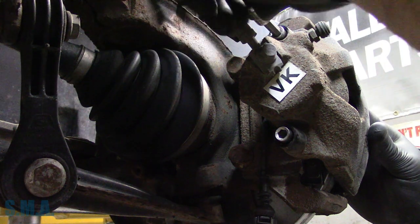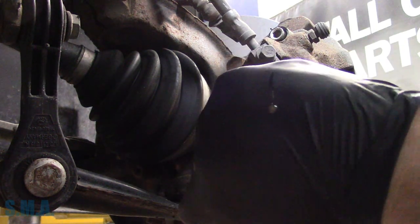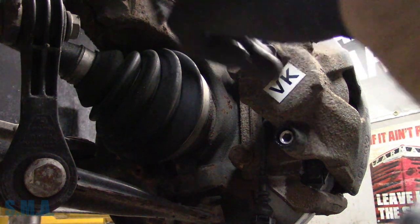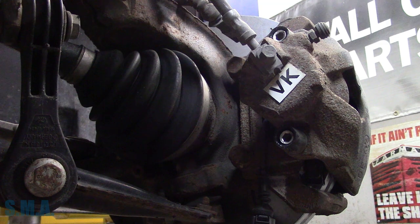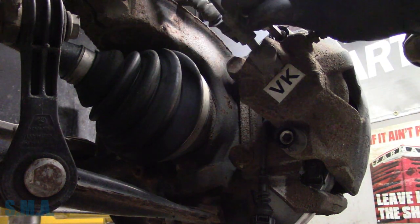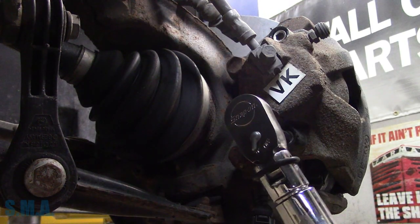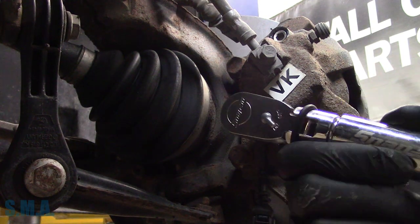We'll get our pins back in here and get them started. On Chryslers and Jeeps, those bolts strip out wicked easy — they're a really odd thread, like a 9mm thread. These are torquing down at 28 NM, which is 20.7 foot-pounds. That was close — I thought it was about 18 — but I was just judging off the feel.